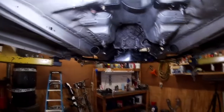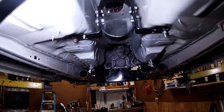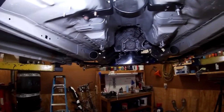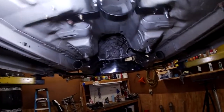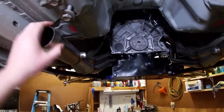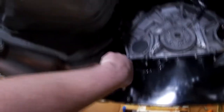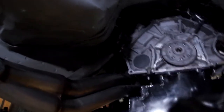Under here we're already ready to accept the transmission pieces. I'm sure there are a bajillion write-ups on how to pull the transmission out of these cars, so we'll skip that. I do have 2M stainless long tube headers — these things fit mint. With the bell housing it was very close here, so I did grind the bell housing a little bit and I'll show you that. Make sure you have your reluctor ring here.